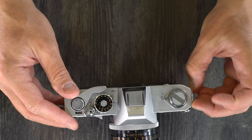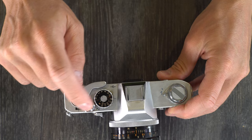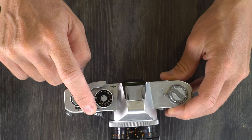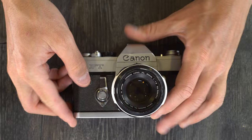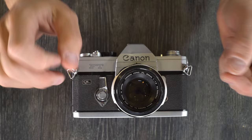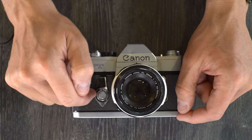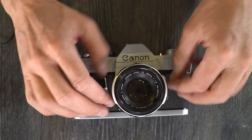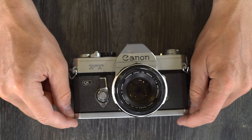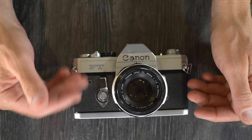Getting one of these repaired is increasingly hard. Before you're done using it, activate the shutter — even wasting a single frame of film is cheaper than having the shutter repaired. Also, don't touch the shutter curtain or the mirror. Touching the shutter curtain and accidentally triggering it can brick your camera. Touching the mirror can cause finger oils to tarnish the silver, impairing your ability to focus and the camera's ability to meter. Don't let the camera get wet — these aren't weather sealed and internal components can rust. Don't leave your camera in your car, because heat can cause lubricating oils to get thin and migrate to places they shouldn't be, especially onto the aperture leaves.